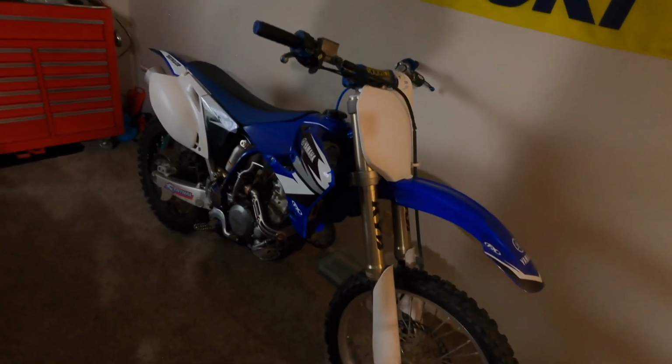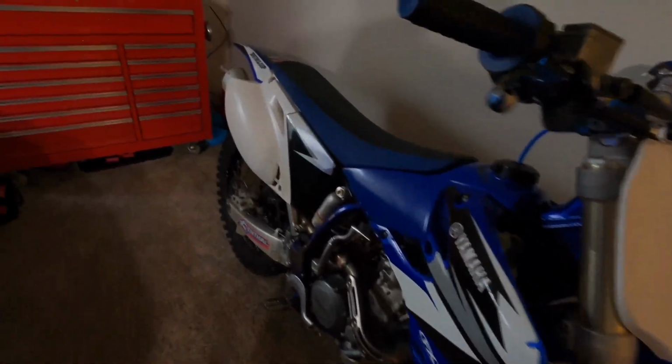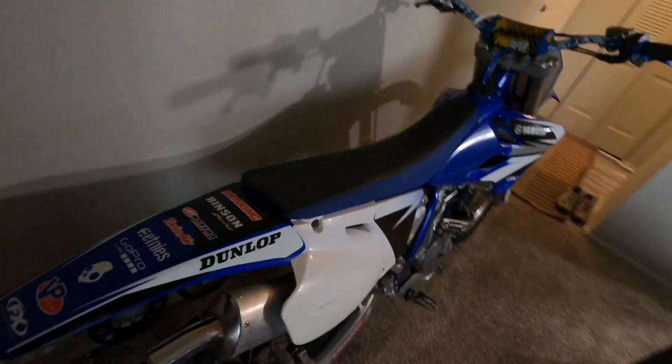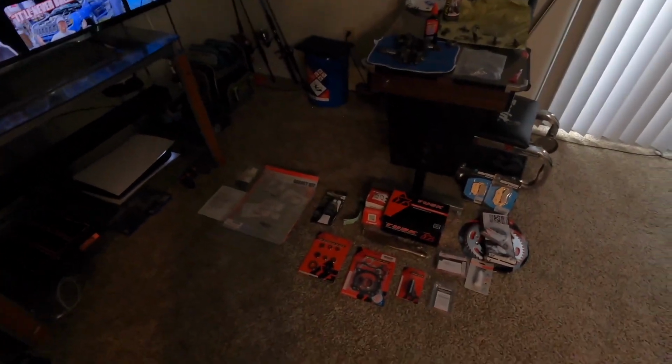It rode good through the first 4 gears, but 5th gear was blown out, 5th gear neutral. So yeah, I went around and rebuilt it today. Split the cases. I got everything set up. This isn't all the parts I need. I still got things on the way.